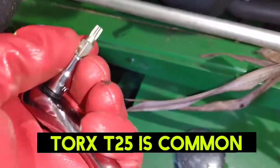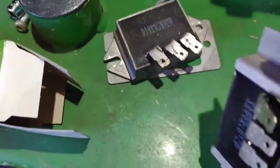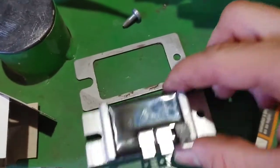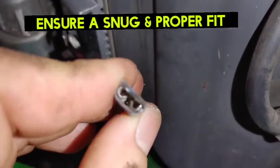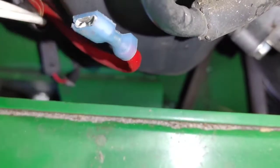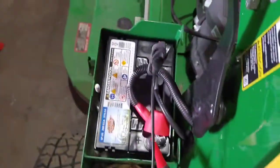I know now it's my regulator. I've got the new regulator — sometimes these are held on with a 10mm, but this is common to a Torx T25, especially on commercial units. Really easy — just two screws. Sometimes the new regulator looks a little different; notice how this one has a tab off to the side for the red wire. You'll want to reuse the little backing plate. They've upgraded it to this newer part. Ensure you have a really snug fit on the connectors — I'll clean them out and crimp them down, because a loose connection will burn up the regulator.